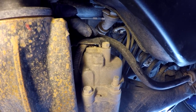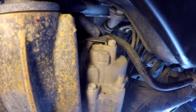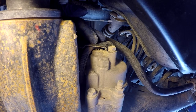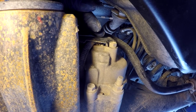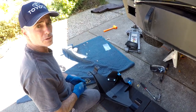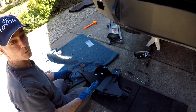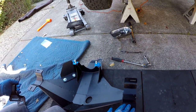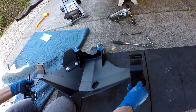The instructions say we might have to remove the little OEM e-locker housing protector plate for the C4 differential skid to fit. We're first going to try fitting it with the protector plate in place, and if it gets in the way, we'll remove it. We test fit it and it looks like we can keep that OEM e-locker protector in place — we don't have to remove it. By loosening the rear sway bar brackets, we were able to tilt the skid into position no problem.